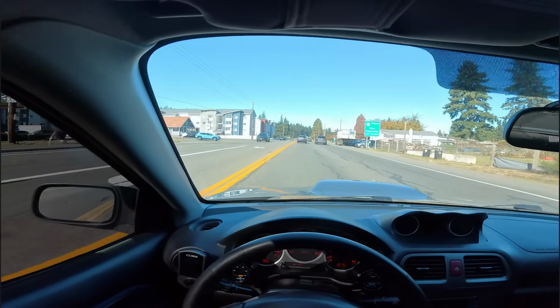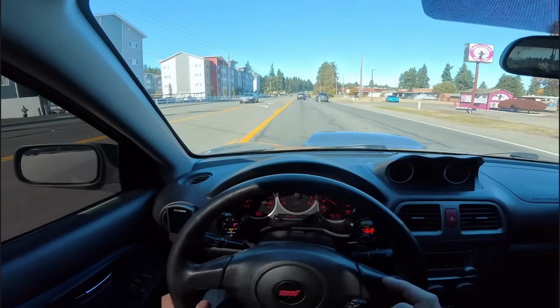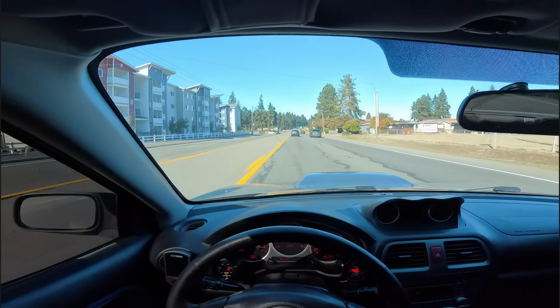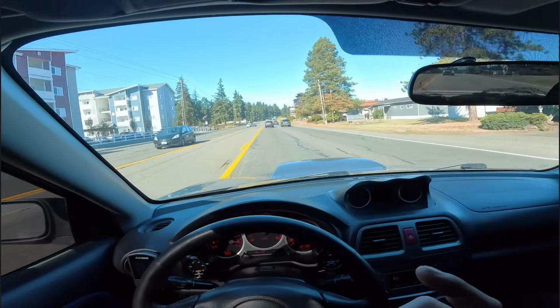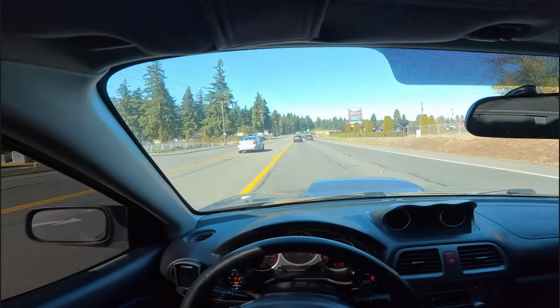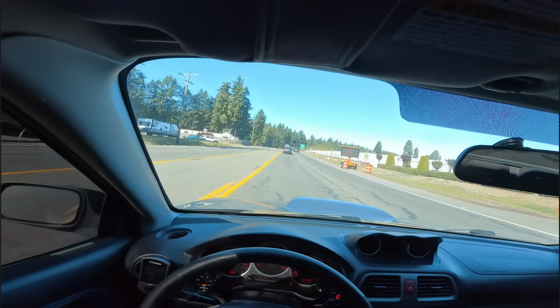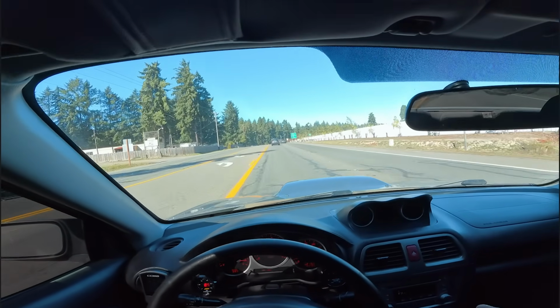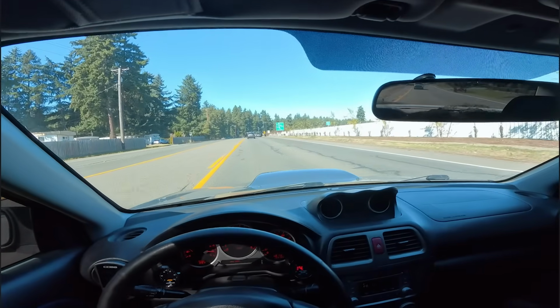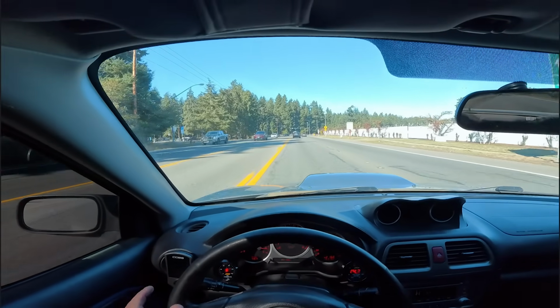With that being said, I get the exact same feedback knock reading at the exact same RPM, and under the same load, every single time. I've already tried removing timing from that portion of the map. I've tried all this stuff, and I do not believe it's a timing or a fueling issue. I think the knock sensor is just picking up some piston slap from the drop-in pistons, which I'm not stressing. If it's only pulling 2 degrees, it's only pulling 2 degrees.